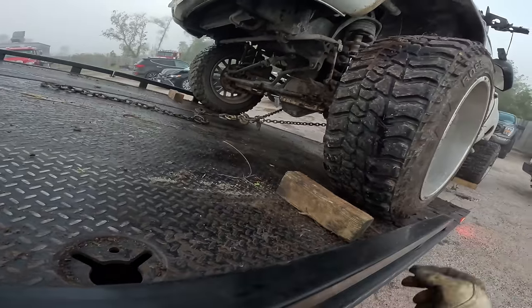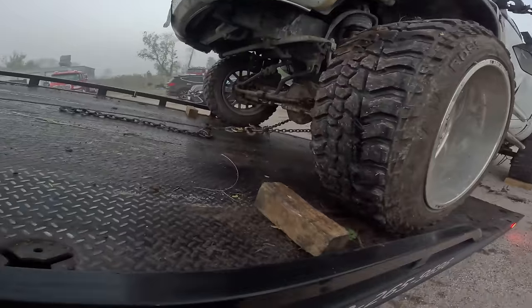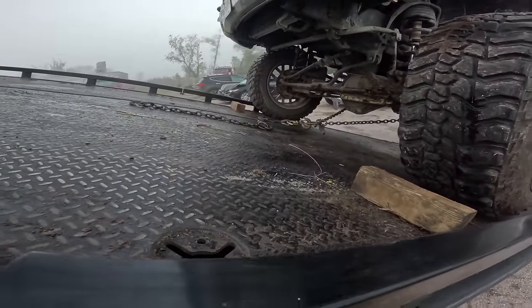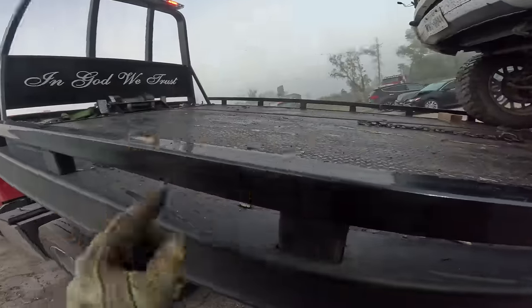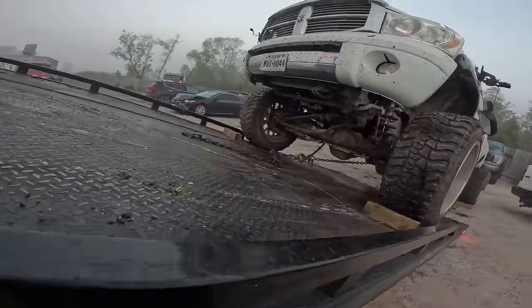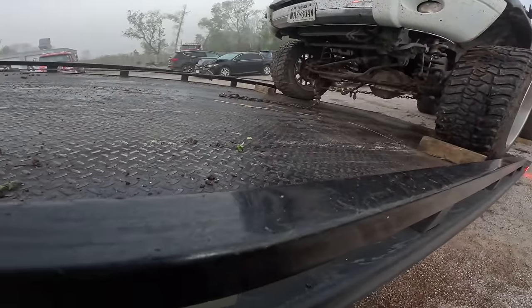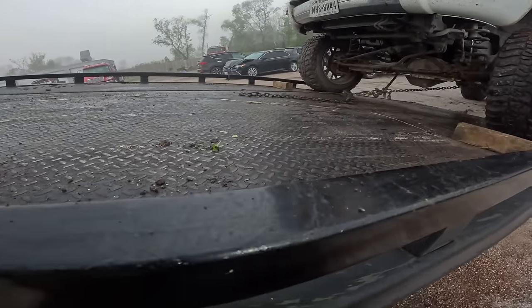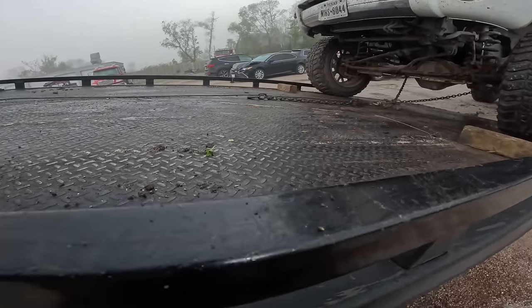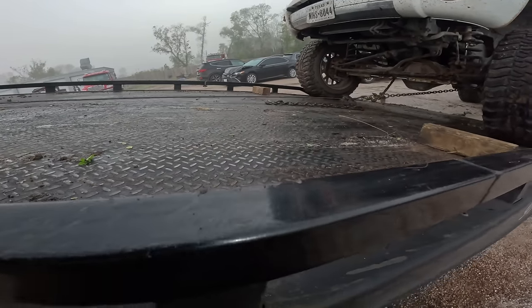Like I've shown in a couple other videos, for my truck at least, this fourth bed slot, so there's four bed slots. When that bed slot is even with you, that's as far in as you can get the bed and still have enough pressure to lift the rear end of the truck to walk out from underneath it. So, we are going to keep walking out.